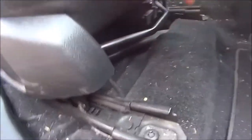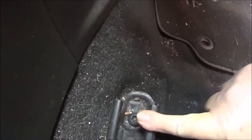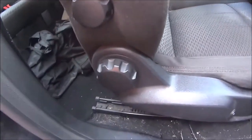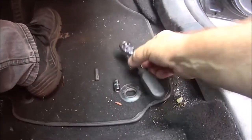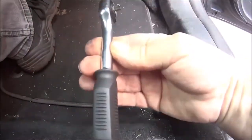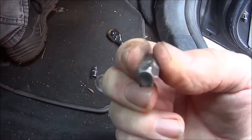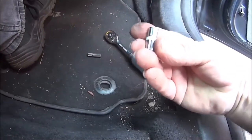The first thing we need to do is slide the driver's seat back so we can find the fixing bolts. There are usually two at the front and two at the rear, and on this Mondeo they are Torx 55. There is also a little electrical box attached to the seat underneath. I'm using a small quarter-inch ratchet with the Torx 55 bit in an eight millimeter socket.